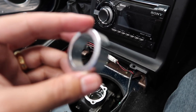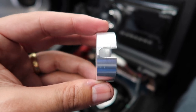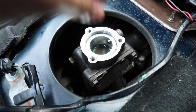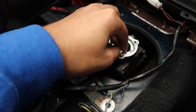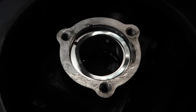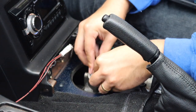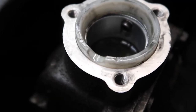You're now at a point where you can start taking the bits out of the kit and fitting them to the vehicle — the exciting stuff. First off, you have a spacer which you insert like so — simply drop it in. The next part is a little metal washer which has got three tabs on it. That is designed to coincide with the nylon spacer or bush you removed earlier. Place that on top, and then reuse that original nylon part, only this time mounting it in a slightly different way — hopefully the clips show you what I mean.